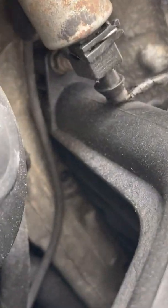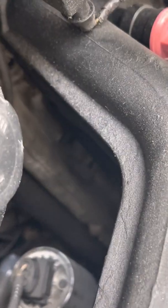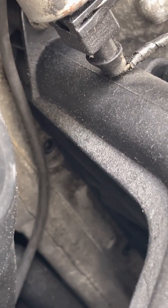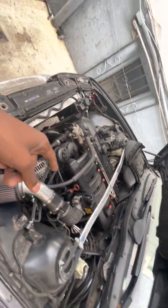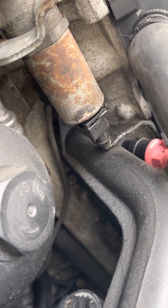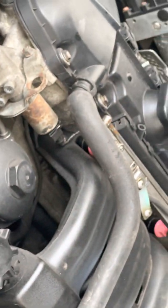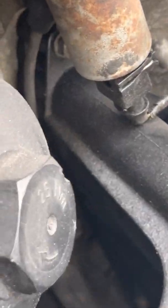There are two very important things I want you guys to understand. One: on the M52 TUs, or just any dual vanos setup, there are these ports that the CCV valve uses to recirculate oil back into the intake. There is a kit on SeemLegitGarage that I will link below. M50 vanos, or M50 intake — just look it up on SeemLegitGarage. You're going to get these little studs. I found them at Home Depot too, but either way, you've got to plug those holes first.